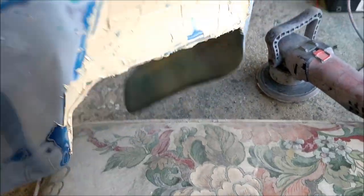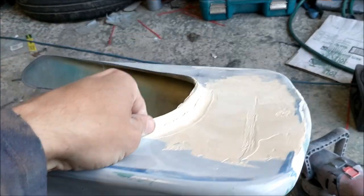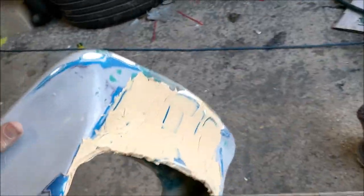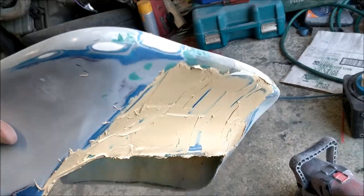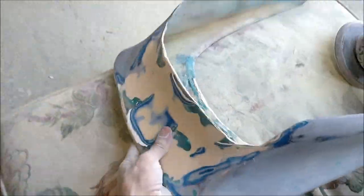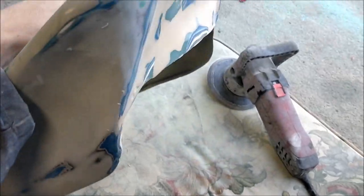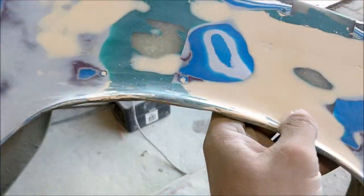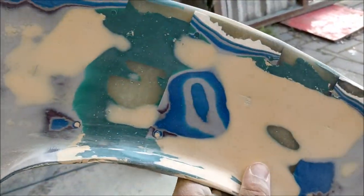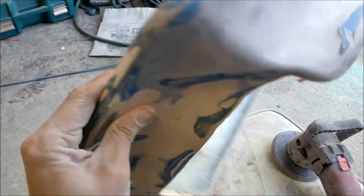Back at it again with the spoiler — got some spotting filler on here now. It's a bit messy but once it's sanded and smoothed out it should be pretty good. After a little bit of sanding it's quite smooth now — pretty happy with that, it's quite solid really. It's come out way better than I thought it would. A little bit more spotting filler in places and then some high build primer — ready for paint.